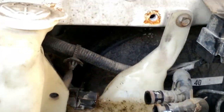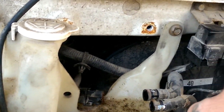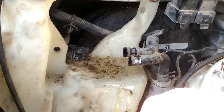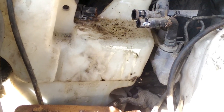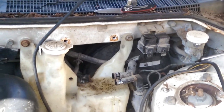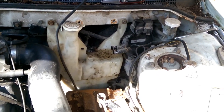To get your reservoir moved out of the way, you've got two bolts here on this windshield wiper tank — loosen those up, pull up on it, and watch your pump. You can actually pull out on your pump; it just sets in there with a kind of o-ring type setup. Set something underneath the car to catch your fluid — if you don't, it will go everywhere and that makes a mess.